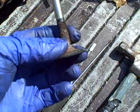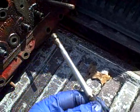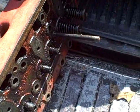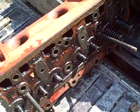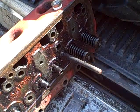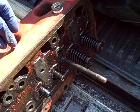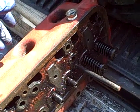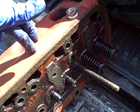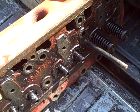This is something of interest. This is the only exhaust valve that came right out — it wasn't stuck at all. The reason I think it is interesting is because this is the cylinder that had that weird extension on the spark plug welded onto it. Somebody online messaged me after seeing the video and said that extension is there to keep the spark plug from oil fouling — some kind of a remedy if you had a cylinder blowing oil to keep the plug from fouling. So I wonder if this cylinder had a problem with oil fouling the plug, and maybe that is why the exhaust valve didn't seize up — maybe there was a lot more oil in that combustion chamber than there should have been.